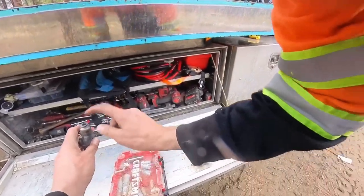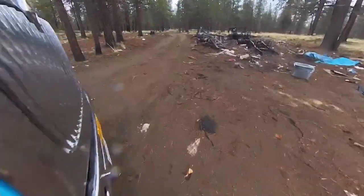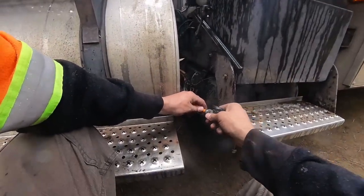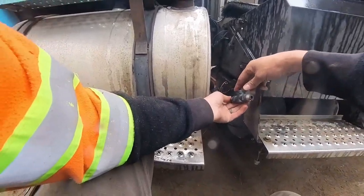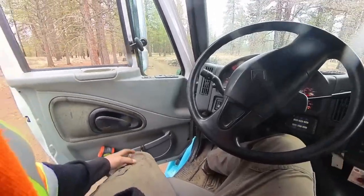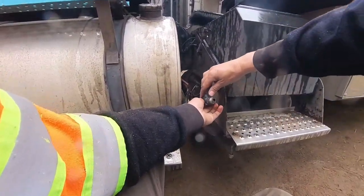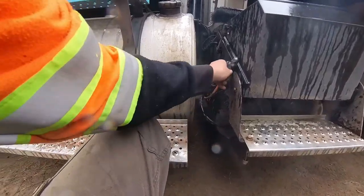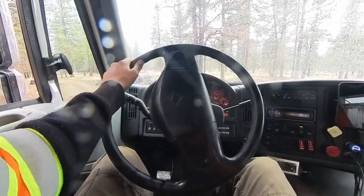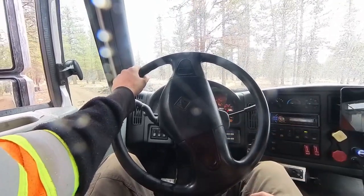Okay, get smart here. Please be the right size. Be smarter than the truck. That's a secondary tank. We don't need it. This is the supply line to the tank. So now if we start the truck, there's the supply trying to feed the tank. No more air leak. Now, we should see these gauges start to come up. Well, this one.